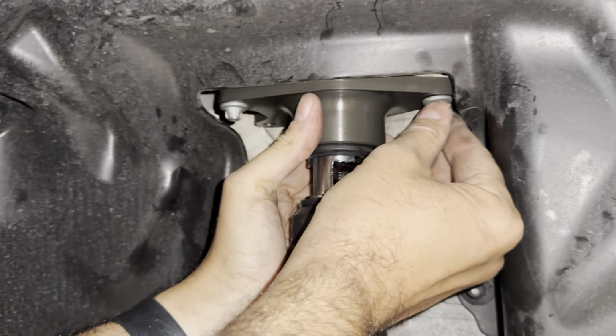Okay, now our spring is pretty short here. It's basically as short as it goes. Probably put a little bit more preload in that, but that's 50 on the back. Okay, so I've got that 5 millimeters of preload in the rear spring. I've locked off the bottom nut.